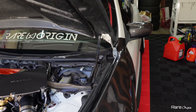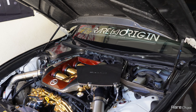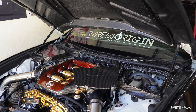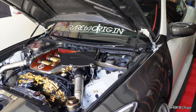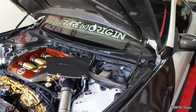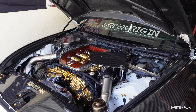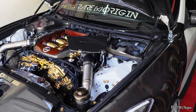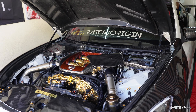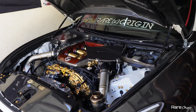I was going to do it right here at the garage, but I don't have the tool my friend has — the one where you plug it into the little bolt and all the fluid starts coming out, which keeps it clean. I think this takes DOT 3. I'm going to be showing you how to bleed your clutch so it works perfectly. When the car is hot, gears don't want to go in — I'm having the most trouble with reverse.